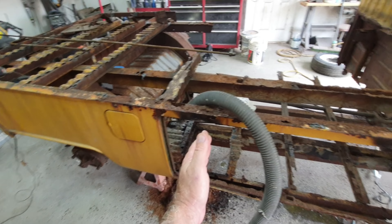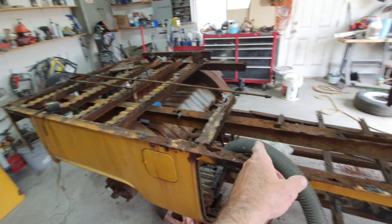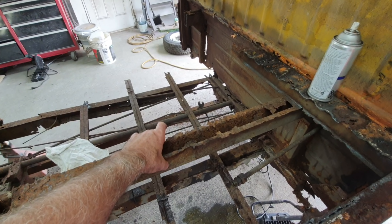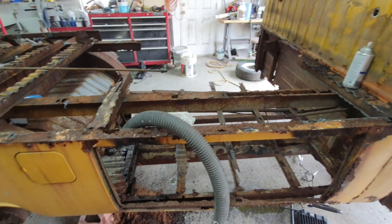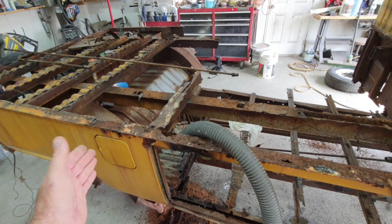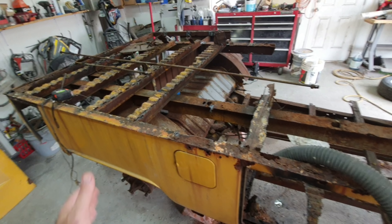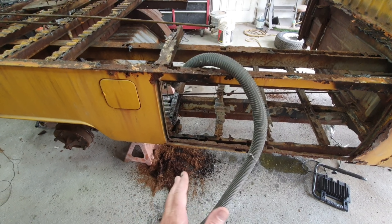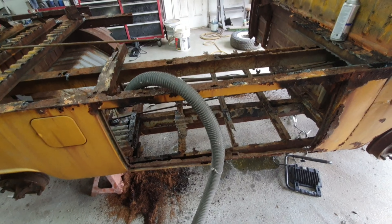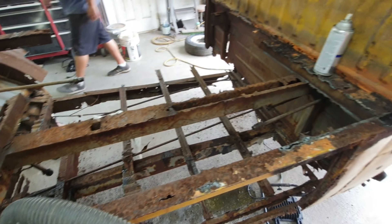So we're thinking about cutting this thing off — we'll have to cut through this piece here and get our measurement all the way back. This is going to be one-and-a-half by three, 16 gauge, which is thicker than what's on there. We'll have those all set up so when we put it back on we can remove the rest of this, the top hat's there, and slide the new frame pieces in for the top — and put it all together in one go. It doesn't look that bad in the front, so that's pretty exciting. There's a lot of bad stuff in the back, and it'll be fun to watch. I'll talk to you guys in the next video — please like, share, and subscribe.